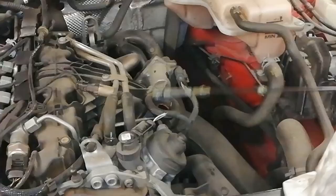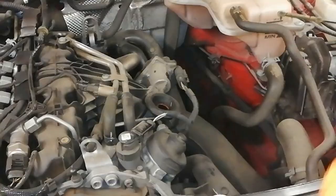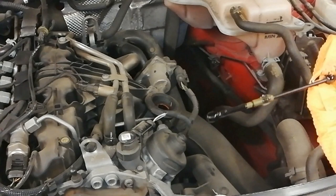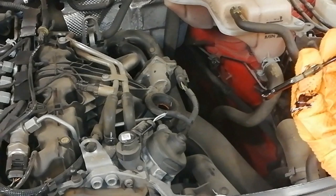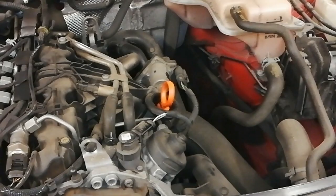Checking the dip gives an indication — maybe there's a leak. We'll have a wee look on our inspection later on when we get underneath the car. So we dip it and it's not too bad — just shy of full. There's a wee bit used. I have no idea when the last time this was serviced; this isn't my car. I don't know whether the owner has been topping it up — he certainly didn't mention that. But it gives you an idea.